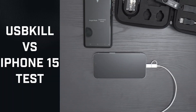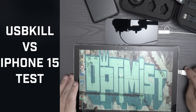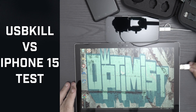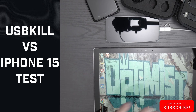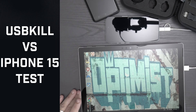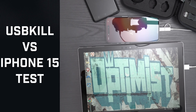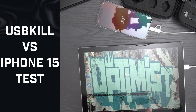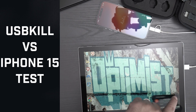So let's test the port to see what is going on — specifically whether the data port is still working, because normally the data port is the first thing that dies on the iPhone. We plug the phone into the laptop. The phone is charging, but it's not detected, and we have a message on our Windows: 'Power surge on the USB port.' It's definitely what happened.